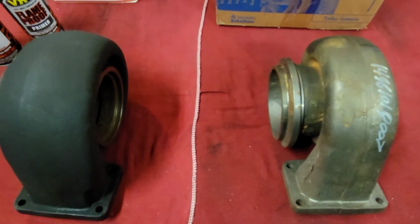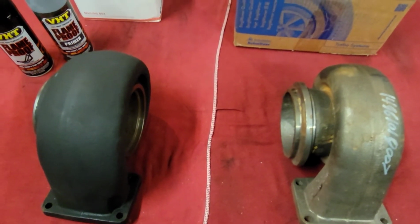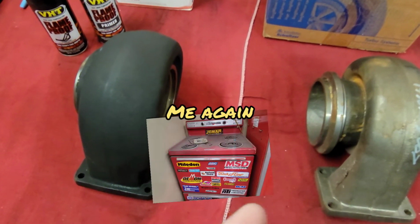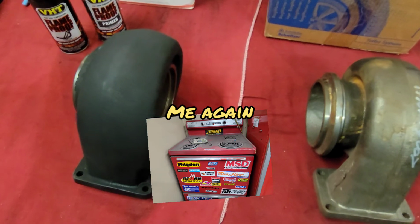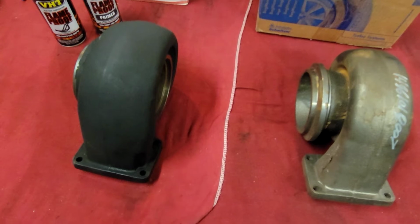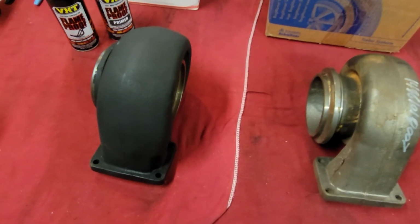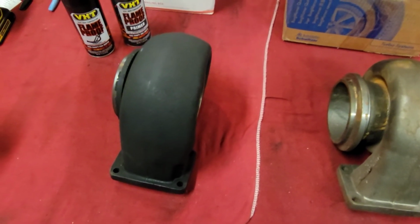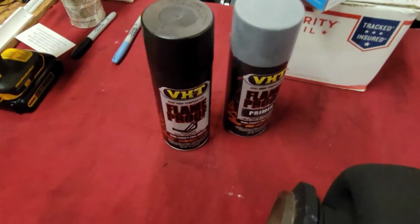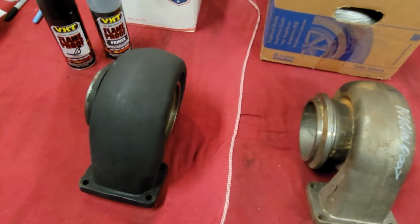And basically I used a small wire brush and some acetone, cleaned it up really good, heated it up in an old oven which I think I got a picture of, and I'll post that picture in here as well. It's just an old oven that we stuck in the shop so that we could use for powder coating or doing whatever. And this process actually works. I learned this a number of years back because we used to coat pistons with this stuff, SP101 or SP118. I forget which number it was, but VHT. It was a poor man's piston coating is what we did.